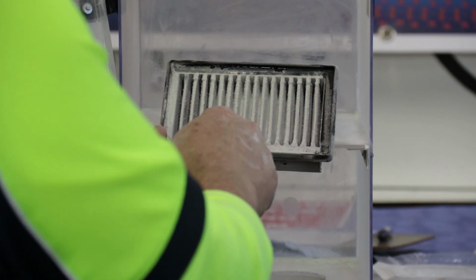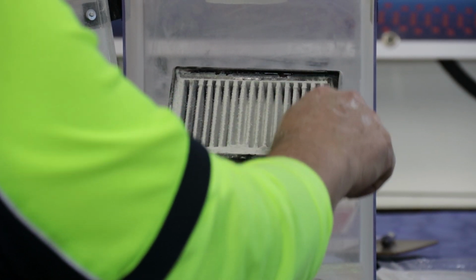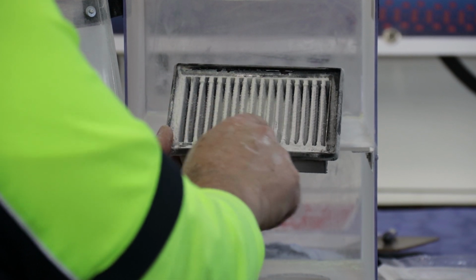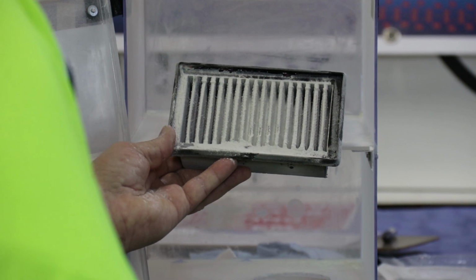And here's a close-up of the K&N filter after 30 grams of BestRest and 30 grams of talc. The center part of the filter is totally filled with powder. The outer edges still have a little bit of fabric that I can see, but there's a huge amount of powder that is just sitting on top of the filter.